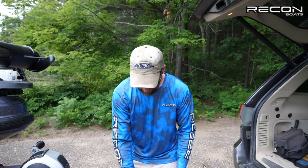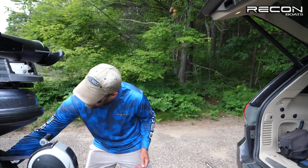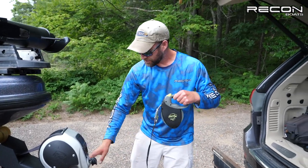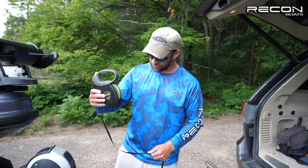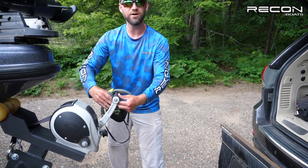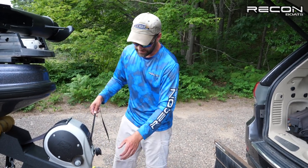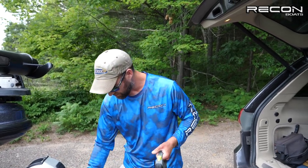So the next thing that I do — make sure that your rig is totally unhooked: transom saver, straps, all that kind of stuff. We'll take the safety off here and unhook the boat. It's actually very simple and effective. Now the trick here, and there's a couple different ways you can rig your dog leash, is to just rig this right on the handle here. This particular one seems to lock into position. It's not 100% necessary to have your dog leash lock in, but this particular one does a great job. They don't need to lock in, but it's helpful for peace of mind that your leash isn't going to fall off the winch handle.